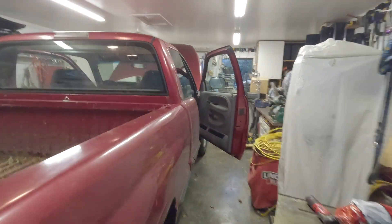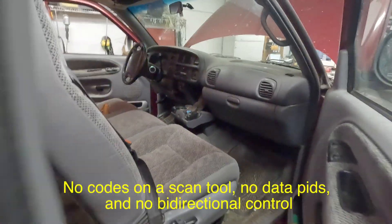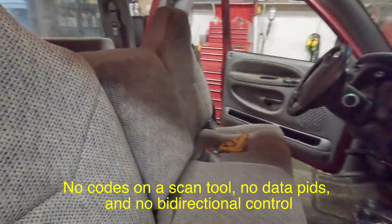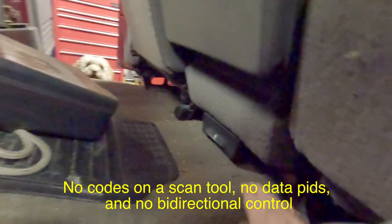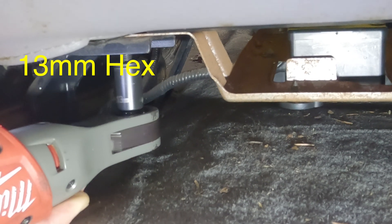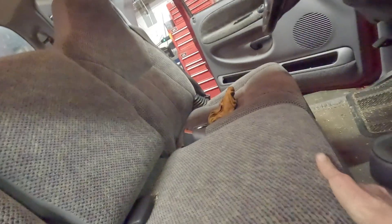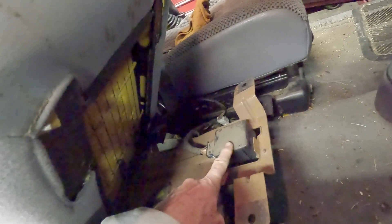What we need to do now is get at the seat belt control module. Fortunately it's fairly easy to get to. It's suspended underneath the middle seat, and for this particular style of vehicle the seat is held in place with four bolts — one there, one over on that side, one right under here, and a fourth. Once you get those four bolts out you can pry the whole thing back like so, and that's the module we need to get at right here.